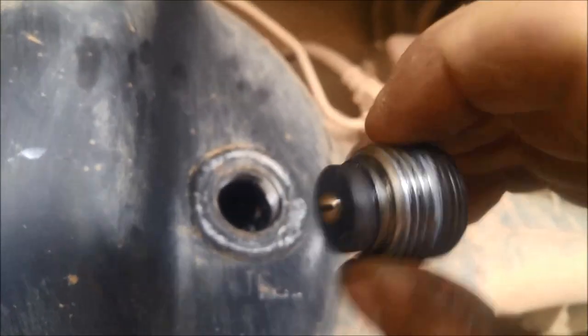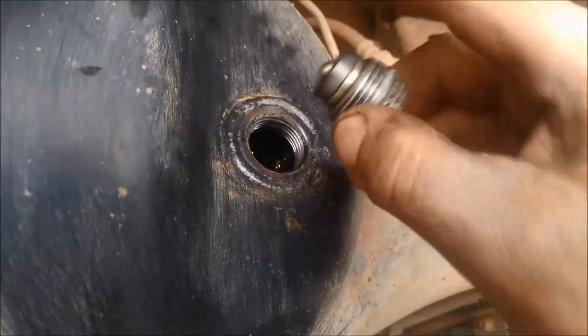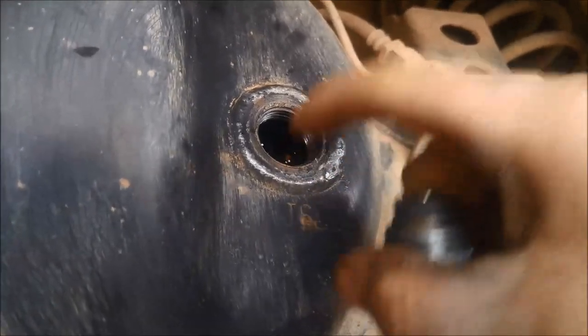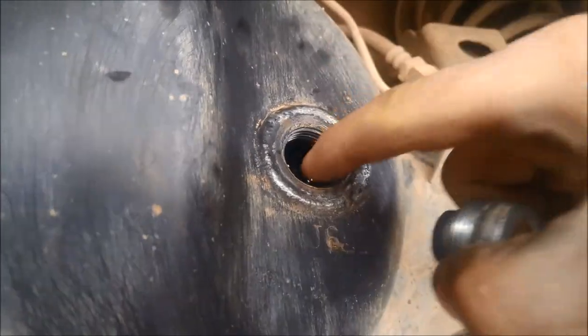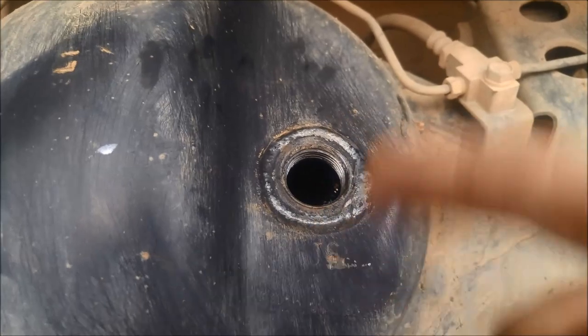I'm going to put the one that was on the bottom just on the filler there as an additional magnet — very handy. But just make sure if you're putting in a magnetic plug, especially one that's sticking out like that, it's not going to magnetize the crown wheel or any bearings passing by that magnet. This one's got a fair bit of room, so you can do that.